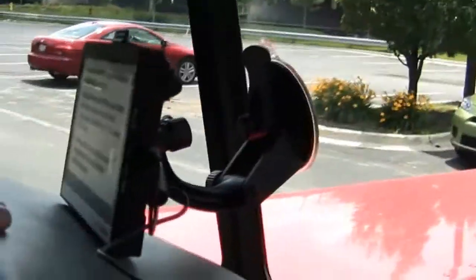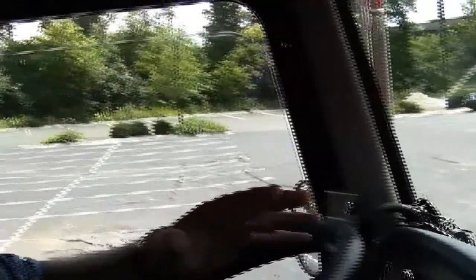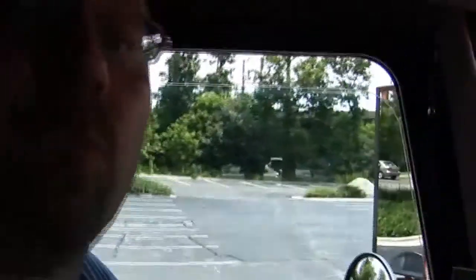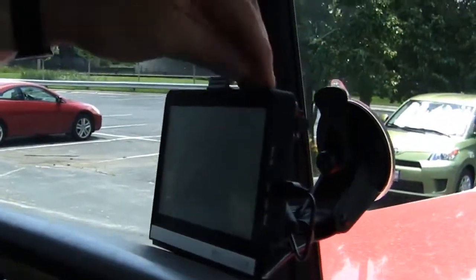To maximize your battery life, the first time you set it up you should have it plugged in for at least two hours straight. When you turn it on, it may take up to 15 minutes to locate the satellites, though generally it's much faster than that. There's also a recommendation on screen to hook it up to your PC to get updates and register it, but it is not necessary to plug it into a computer before you use it — it's ready to use out of the box. The main reason for the computer hookup is for updates and registering. Now we'll remove the protective film off the screen, and we're ready to start it up.